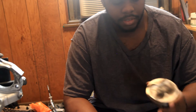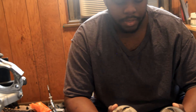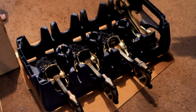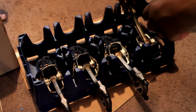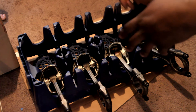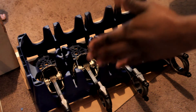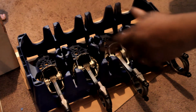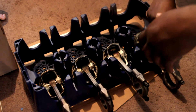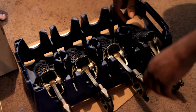We're not going to install them today — just going to take them off, clean these up, and see where we go from there. Here I have the A2 pistons and rods. I'm sure you guys have seen this trick before: we use a soda crate and just put your pistons in, aligning them in order. Obviously these are not from the original block so there's no strict firing order to assign, but I put them in here just to keep things orderly. I'm going to put the A3 pistons on this side and then start taking these rods off.